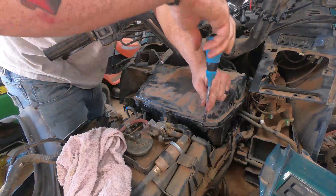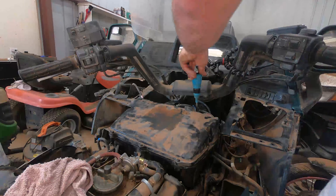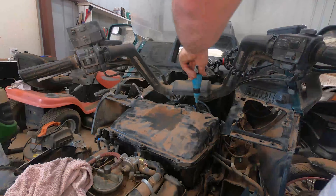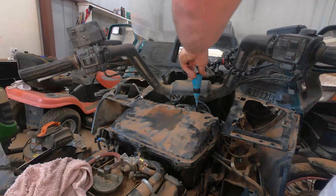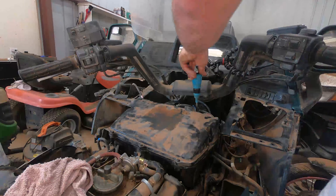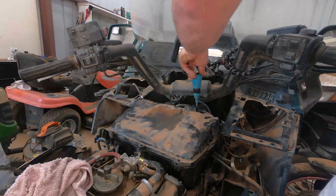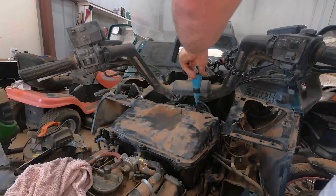This one is an ethylene glycol based antifreeze — it's the green antifreeze, which I love; I've had no problem running it. I'm just going to fill it up until I get it to the medium level on my dipstick. Remember, don't check this while it's hot because it'll be pressurized, it'll blow everywhere, and it could potentially burn you.